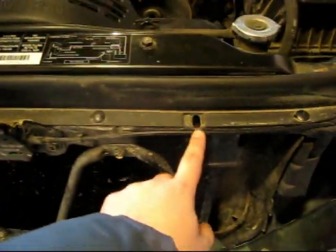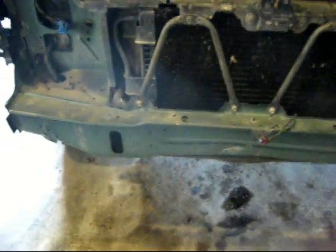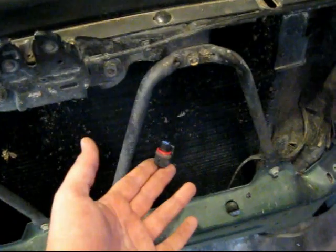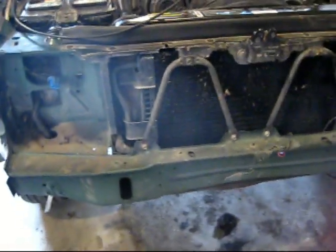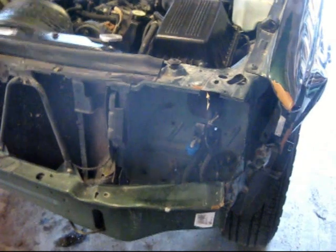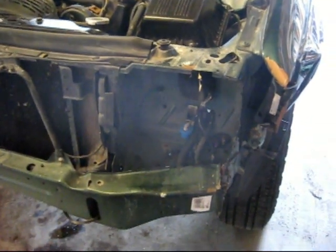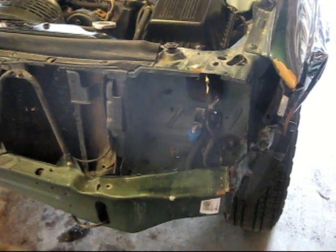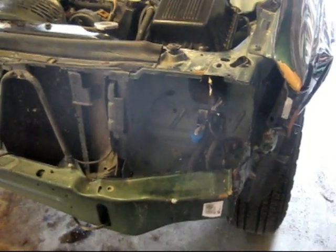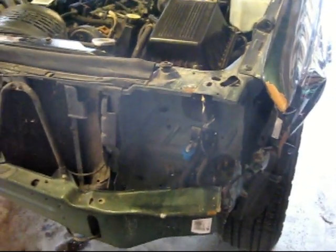There were just about four bolts holding the thing in — here, here, and one down there somewhere. And then there were just a couple of electrical links to disconnect. I have no idea what this one is but it hooks in front of the radiator. I also had to disconnect the lighting connections. What I'm going to have to do is bend that bumper out and try to get it into a proper shape so I can put the new header panel in.